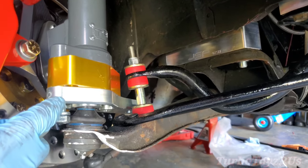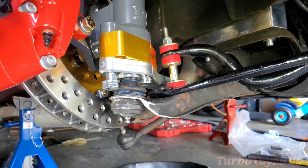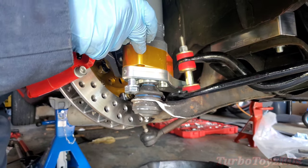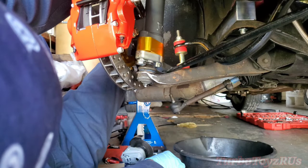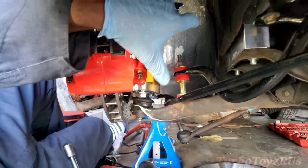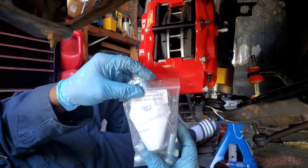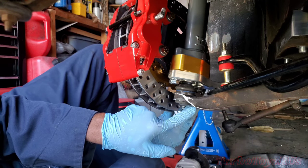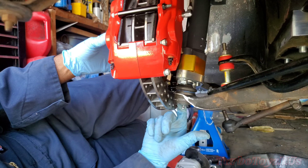Removable dowels in the steering knuckle change the orientation to allow it to be used on more than one of the old school Toyotas. The inserts in this knuckle — you want to switch them around so your RCA will slide over that. Make sure your suspension slides on a dowel, then you're catching your bolt. There's an assortment of bolts that T3 provides — for my setup I'll be using the longest ones with the lock washer. Here you can see where I cut the control arm front, back, and side to ensure that when it's turning it won't touch up on the lower control arm.